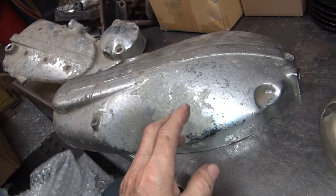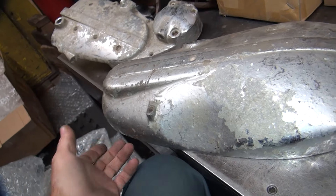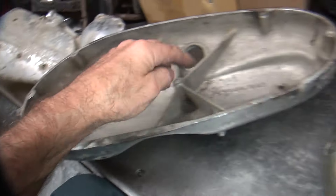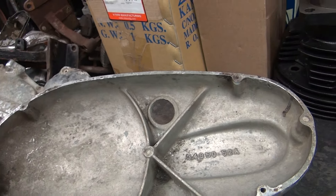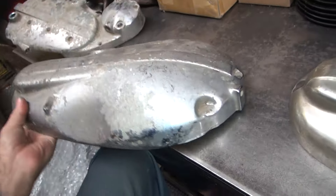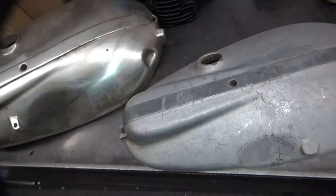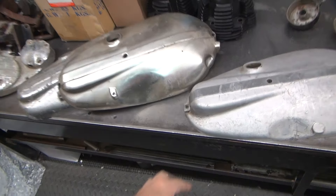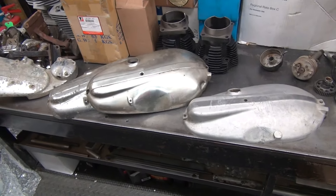The clutch is a little bit taller on the Sportster, so I thought these had to be a little bit different. But this probably has the taller surface through here, and it's already got a little bit more clearance up here for bigger sprockets, so it probably fits. I haven't actually tried doing that, but it looks like it probably would fit. So once again, you've got three bolts that hold it on, and roll pins that go right in here to keep it centered on the case. So this one here, once again, looks like crap but it's not broken — it's in nice condition. These two here are the same, and then we've got the nice one over here for your K-model. If you're going to use a solid sprocket with no compensator, it's also that one — but this would probably hit on a 34-tooth; it's probably only going to work with a 32 sprocket. There you go — three nice covers.